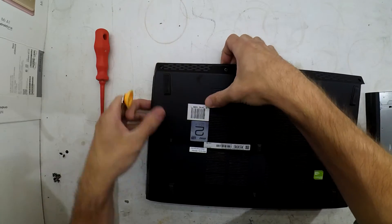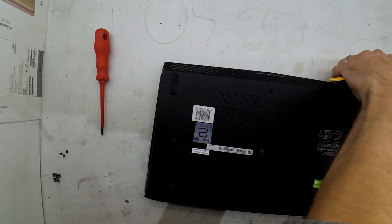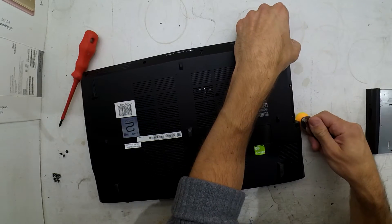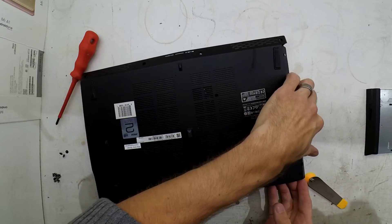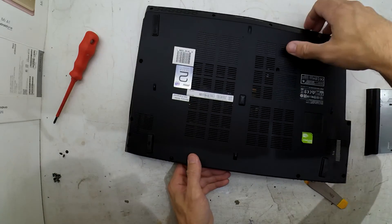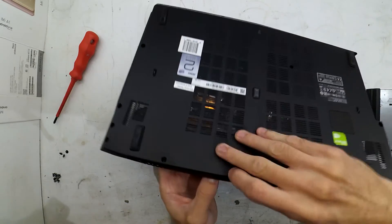In this video, I'm yet to discover the warranty screw. When opening it, I'd work from the DVD ROM side just because there's less I/O that you can hit as you're trying to take the cover off, versus the other side of the laptop that has quite a few components — headphone jack, USB, etc.